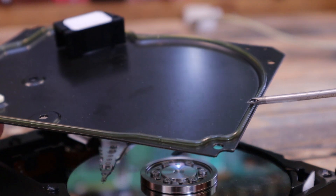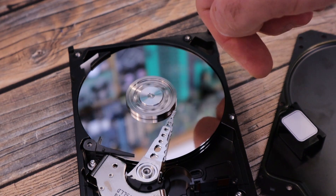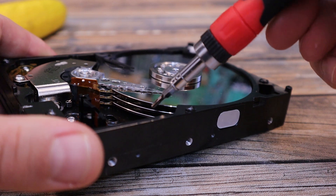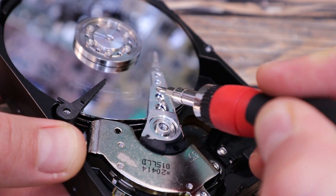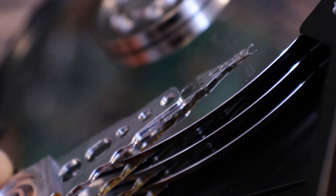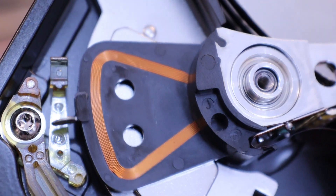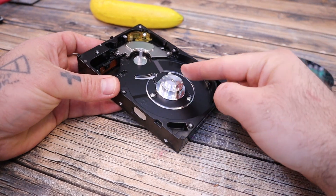When you open the metal case, you'll notice it is sealed with some sort of glue or rubber gasket. This is the hard disc made out of metal, and it actually has a few different discs for more memory. This actuator moves the needle that reads bits from the disc and is based on neodymium permanent magnets and coils. We could use this actuator for a future project based on laser and galvano actuators — so stay tuned. If I take out the disc, we can see the brushless motor.